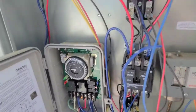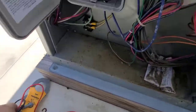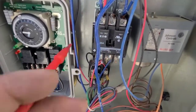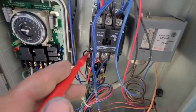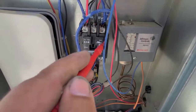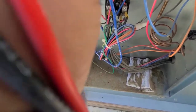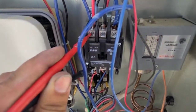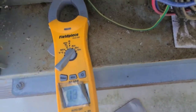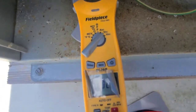What you can also do is make sure your contactor is good. Even if it doesn't look like it's burnt or pitted, you can check for any voltage drop. This contactor is closed, so I should have no voltage differential between this terminal and this terminal in all three legs — I should read close to zero, not zero, or point something. And that's what I got — zero point zero four. You can check the second leg and the third leg — they all look good.